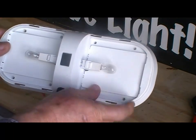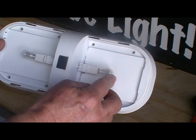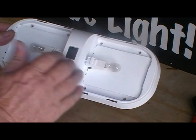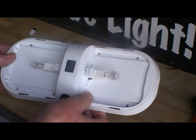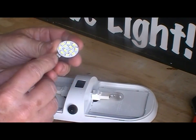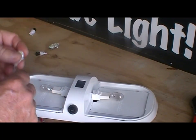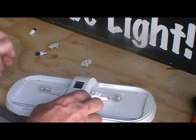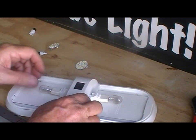The next thing we're going to do is change the bulbs — these are 20W T10 halogens, so in the old configuration you turn the light switch on and you've got 40 watts burning. We're going to replace these with some LED discs — these are the 5630 12 SMD. These are a really bright LED for an internal light. We could go even brighter again, but in my opinion these are the best ones for those light fittings.